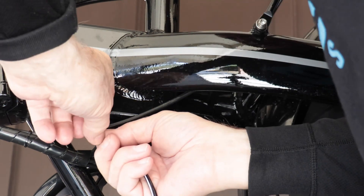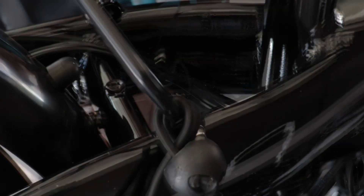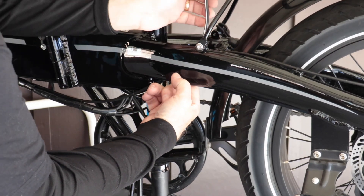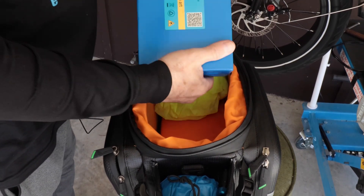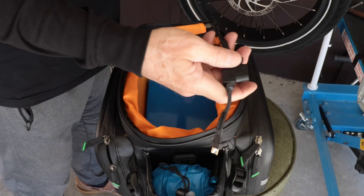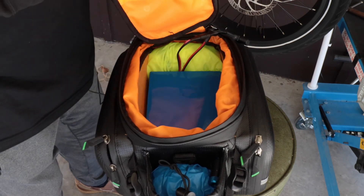At this point, the auxiliary battery wiring harness needs to be routed from the bike tube wiring hole to the bike rear rack. Attach zip ties along the way to hold the harness in place. Once the harness is in place, it should be mostly concealed from view by the bike tubing and rack supports. The Deans T-plug end of the auxiliary battery wiring extension harness — along with the fuse block — will be concealed inside the rack bag.